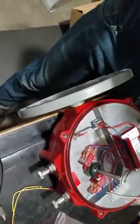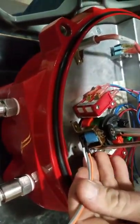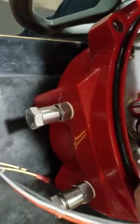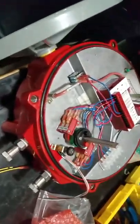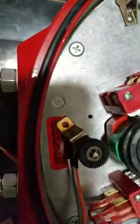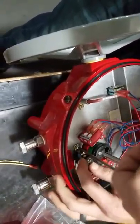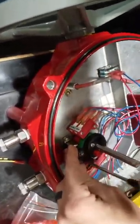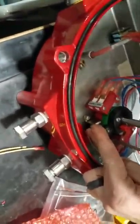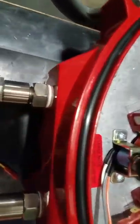Yeah. You have one screw, one lock washer. Put this in there. I always do the first screw loose, put the second screw in, then tighten them together, putting pressure on the potentiometer up against the wheel or cog. Always make sure that's rotated as far counterclockwise as you can get it. Push it up against. Keep it tight against the wheel while you screw it down. That way there's no movement, almost zero gap in between the two gears. So when this turns, it will turn in unison.